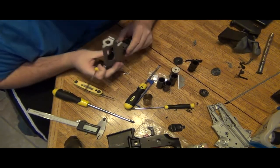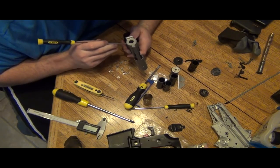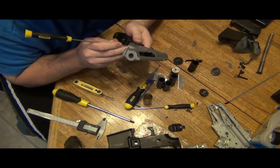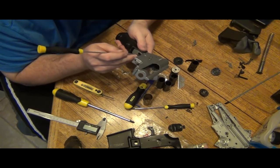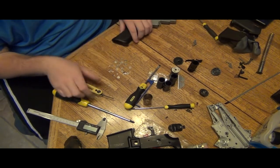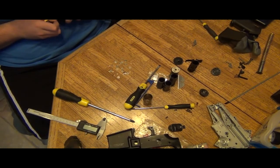If you're ever installing a weak spring to your motor, excuse me, you want to make sure the motor's in the exact same position as before, so I'm looking at the pinion right now. And this does not look like we can put any more shims and go up any higher. But we still don't get the movement that I would prefer. We only get that movement if we move it up higher, so the movement I prefer is probably going to take another 0.1 to 0.2, probably a 0.15 right in between. So we're going to have to basically take some from one side and move to the other. So let's undo this real quick.